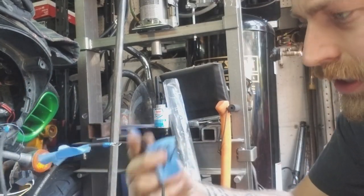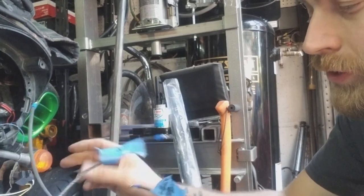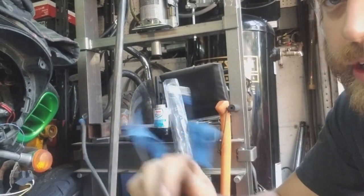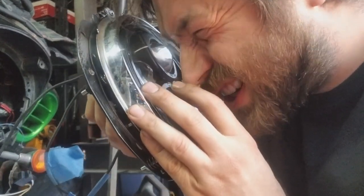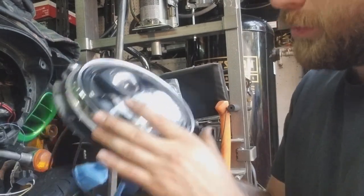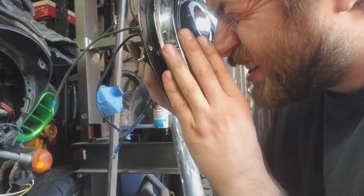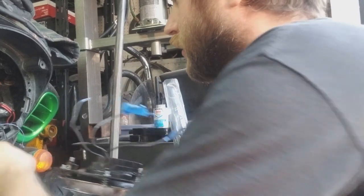Okay. So for the sake of brevity, I just crimped these on here — normally I would solder. Also, if you get a different variety or the Chinese variety of these, it's already going to have the three-prong connector on there anyway. But if it doesn't, you can look all the way inside the bulb and it's going to say high. This is the bigger one — or I guess the lower one's the high beam. But if you look all the way in there, directly below the LED itself, it actually says on the circuit card, 'high beam.' It doesn't say it on the low beam, but process of elimination.